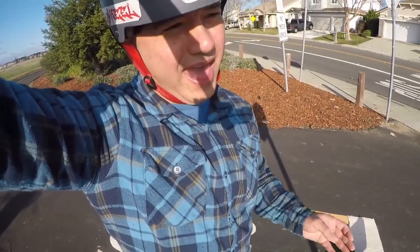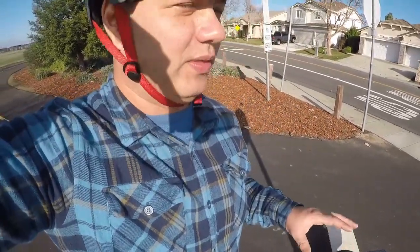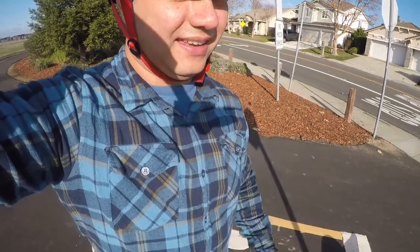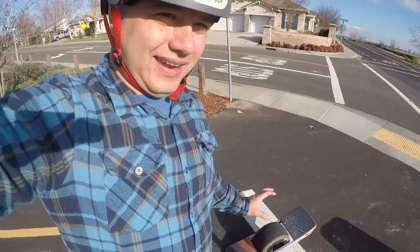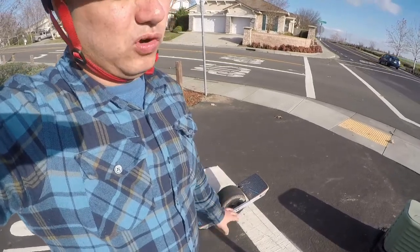It does it well. It's smooth, and also the compound is a lot softer than the D30A treaded Hoosier 5.5 that I tried. It's a lot better than the D30A compound. It makes a difference. The sidewall flexes a little bit more, absorbs a lot more of the shock, and it doesn't go to your knees as much. When I ride a lot, my knees start to ache a little bit, and with the harder tire, I definitely notice it a lot quicker. There's a lot more shock on my knees. The softer one is a much better, smoother ride.